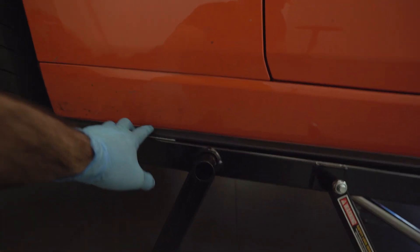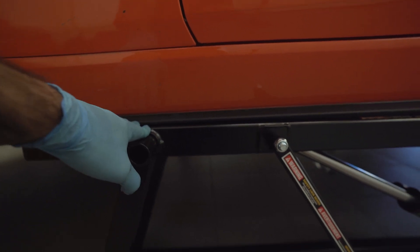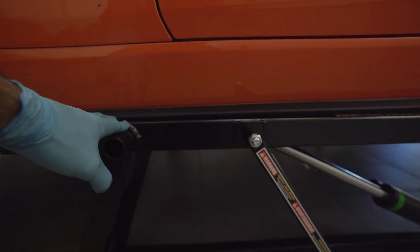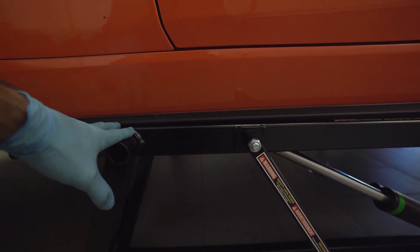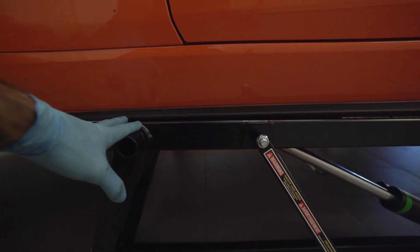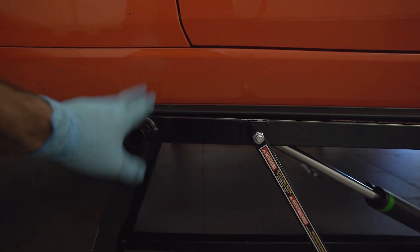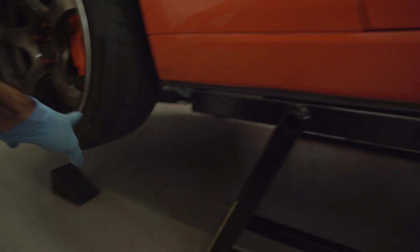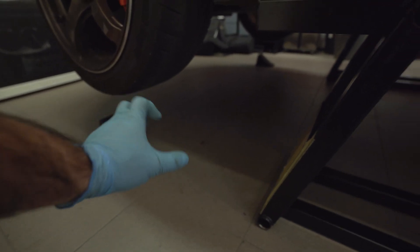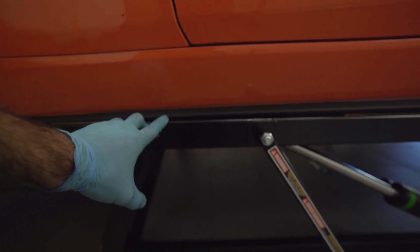In my garage we have a slope from all directions down toward a center drain for rainwater or melted snow, so the frames are not sitting 100% flush with the floor. If I'm working under the car I'll put jack stands under the frame somewhere as well, just to be sure nothing tilts. Good practice is to try to budge the car — as you can see it's quite sturdy. I do need to mention that with the smaller blocks, the block is touching the black trim piece, which is not ideal.